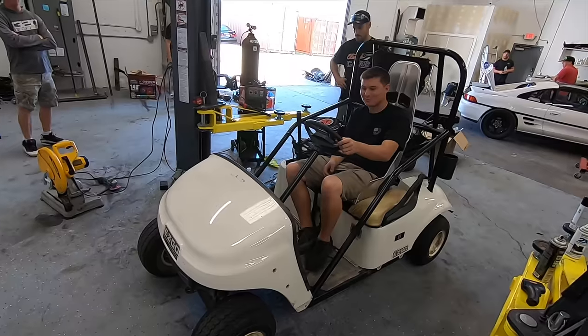Freaking James crushed it, Coop crushed it, Kevin killed it, and Kevin's on his way right now with a chromoly tube for our rear end instead of the aluminum tube. So we're gonna be sliding the aluminum axle out, putting a solid chromoly 1¼-inch shaft in there, which should be much stronger. And all in all, he spent $65 on materials.